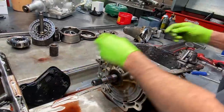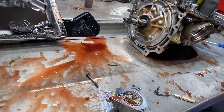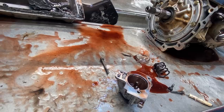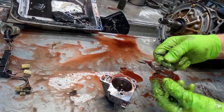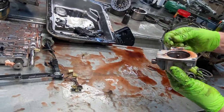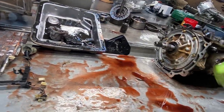So we got our check balls out, of course we got our detent linkage there. We got our accumulator here. They make three different kinds and I like the middle kind — you can put it in there and it will bring the spring all the way to the top. Get rid of this plastic piston here too and put a nice new piston in there. Always scotch-brite your surfaces up where your new seals are going to be running — it makes them slide a lot smoother. You're not getting a jerky accumulator piston trying to squeegee itself down the bore.